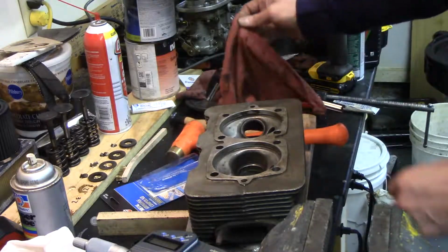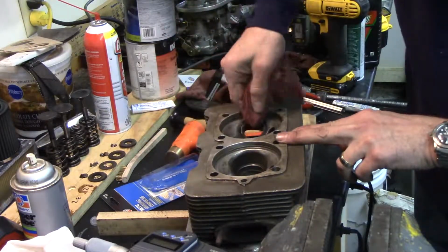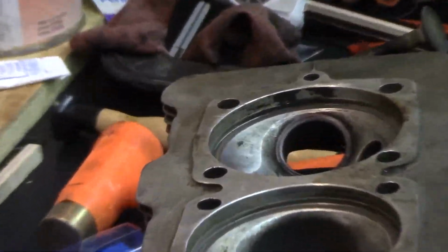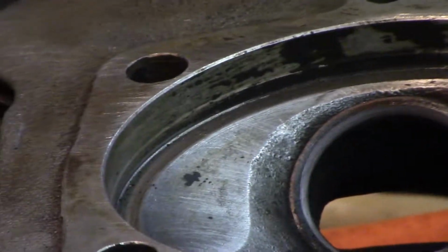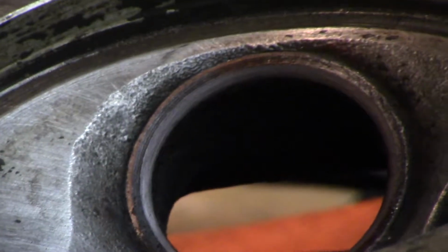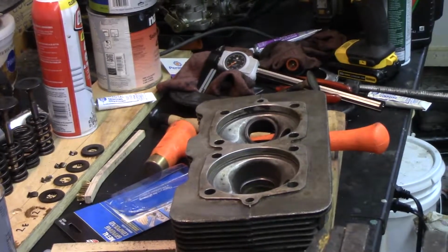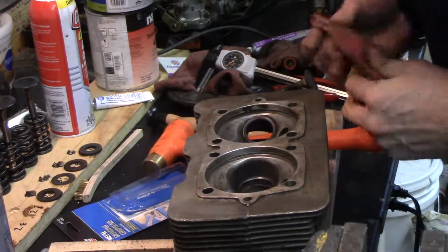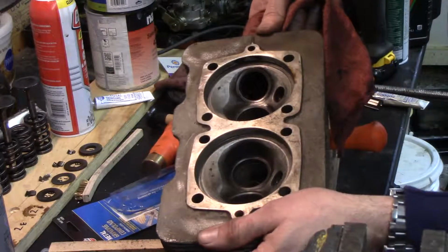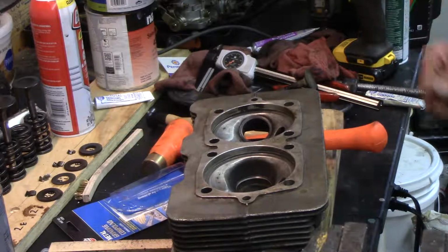And then you can look in here, wipe off the machinist Sharpie. Zoom me back in. And you can see where it did the same pattern in the cylinder, or in the head. And it's dull, and took it all off all the way around, so I'd say that's good. Get set up and we'll bring you back and we'll put some valves in this head.